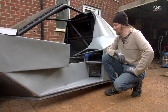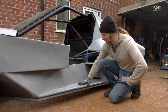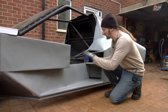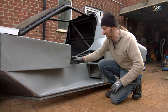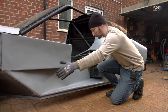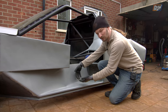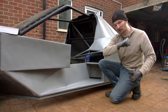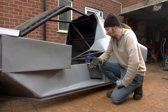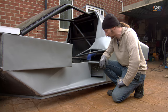Also visible is the first piece of bodywork we did, and it was an absolute nightmare — I hated every second of it. This bottom section in the inner sill area is one piece of steel that we pressed into the framework. The trick we came up with was to take a big piece of scaffold bar, run it along, press it into where we wanted the bend, and pull it inward with a ratchet strap. Somehow it actually turned out okay, but it really did kick our backsides for a couple of days.